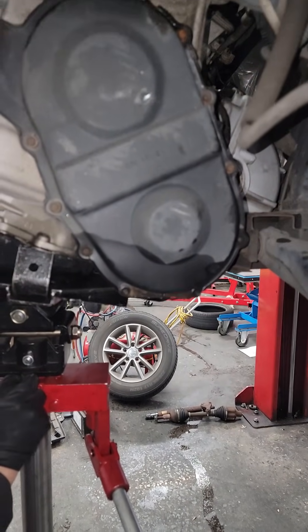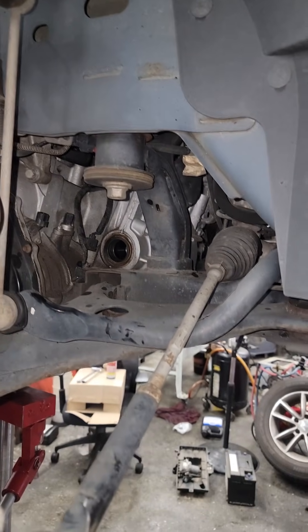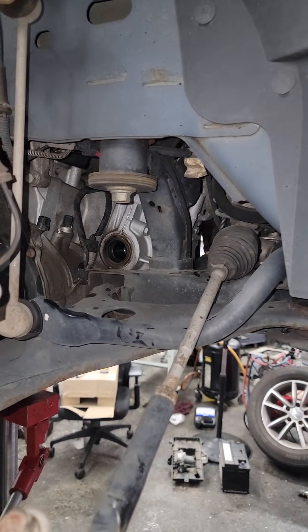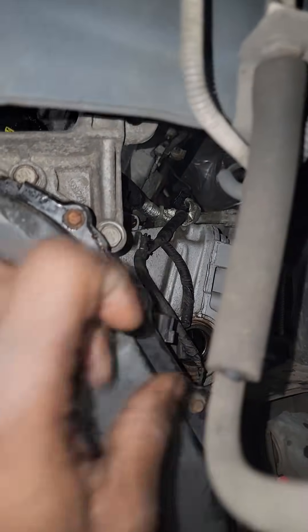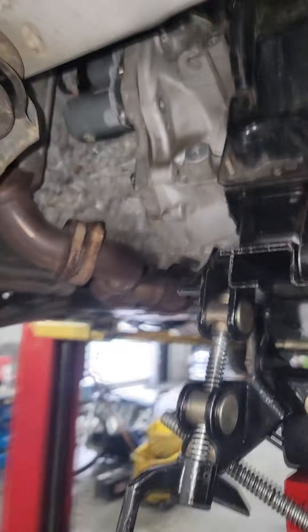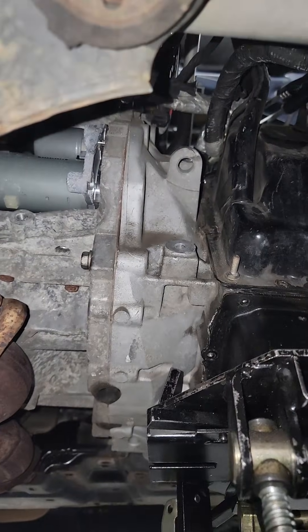It's coming down slowly. Go down enough to where you can see that last bell housing bolt — we intentionally left one in. Can you get through there with a long extension? Those are the only two things holding it up against the engine. Once you get those out, it's easy — we're ready to come out with it.